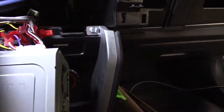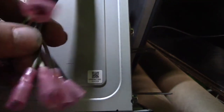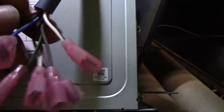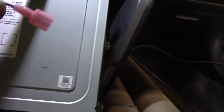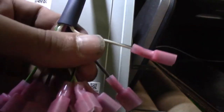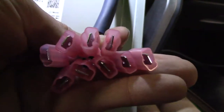It's a red wire that was the best ignition source I could get. All these have to be connected to the right speaker: white is front left, gray is front right, green is left rear, and purple is right rear. I got them all plugged in and got the head unit roughly back into place.